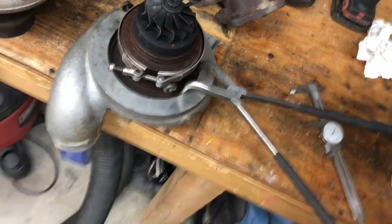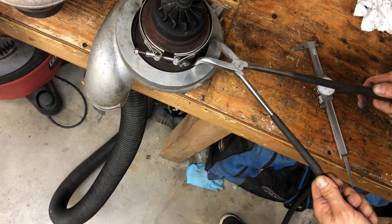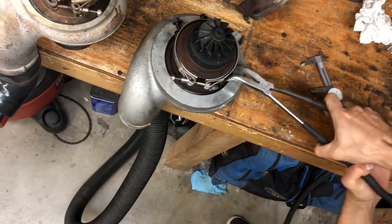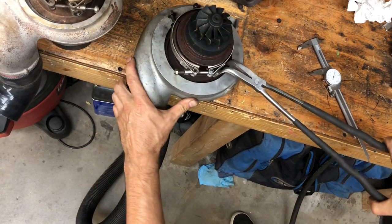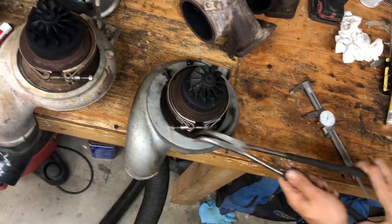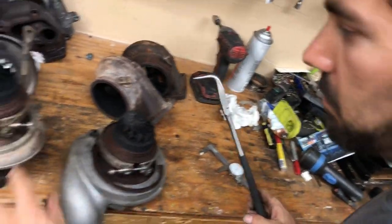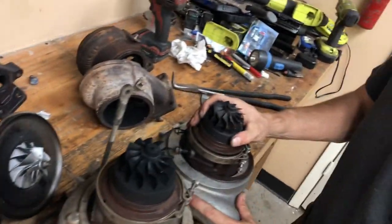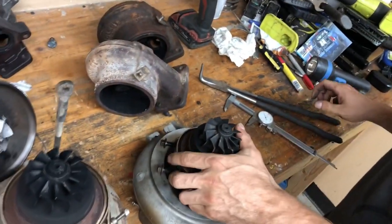I haven't removed this yet, so just hang on. One side pop — there you go, now it's sliding. Lift it up and boom — you need a special tool, so I just modified some vice grips to do it. This one's going to be harder because it's got the wastegate; I've got to pull the wastegate out. Either way, check out the HE351 first — the big boy.